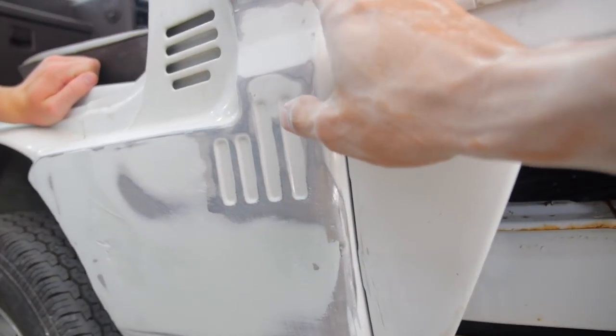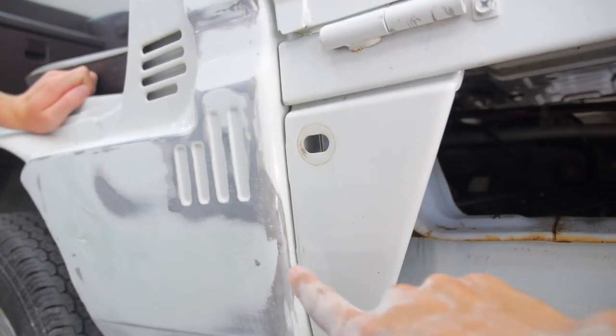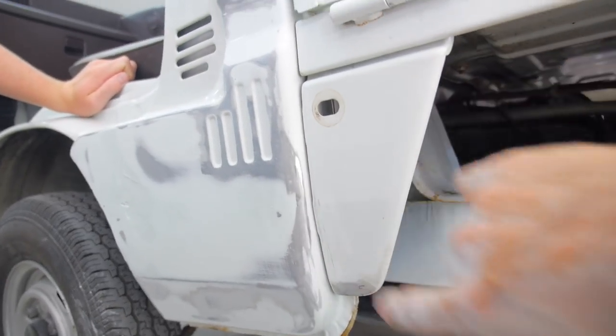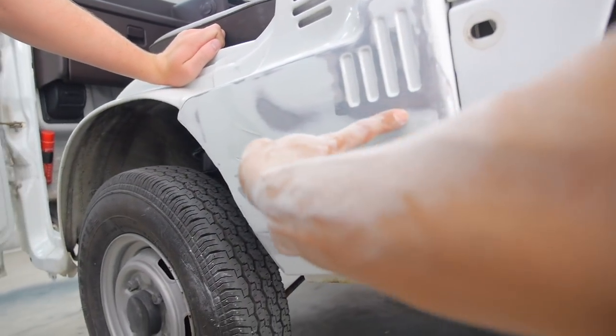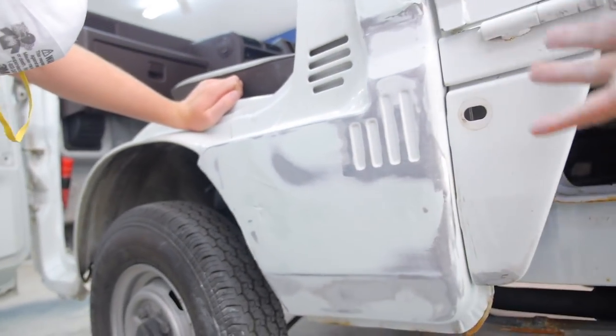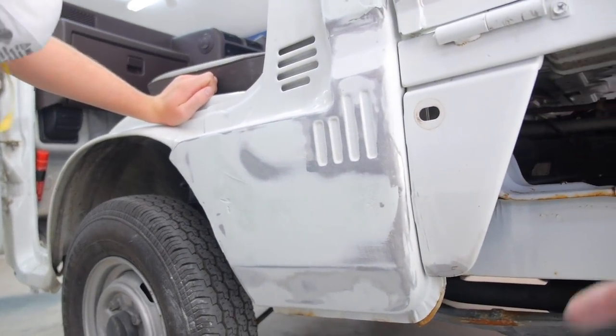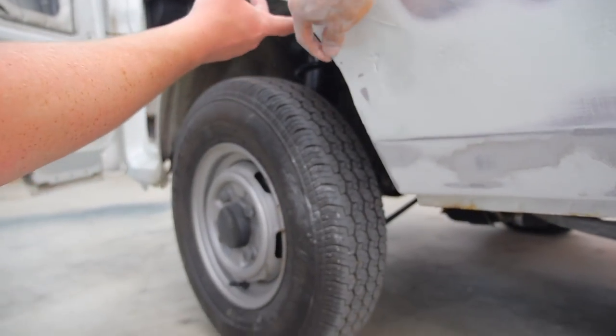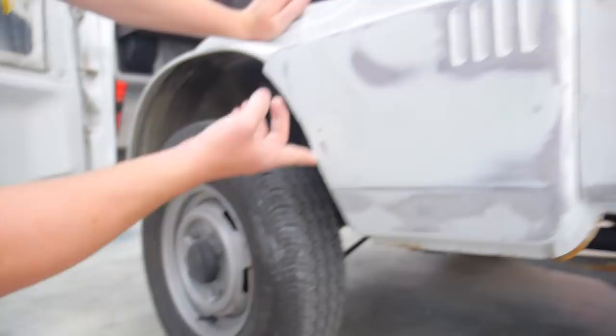Here we have like a little, not there, where was it? Here. If you feel in here, you can feel there's a dent right there, right? Mm-hmm. When we do the next coat of putty, we'll just coat all that, coat in here, block it out again, and then that's pretty much a flat panel, right? You took the dent out, you saw how messed up it was in here, right? Right. We'll recoat this and we'll make sure we get a nice corner when we're done.